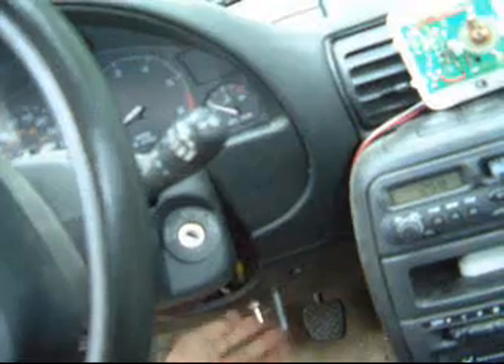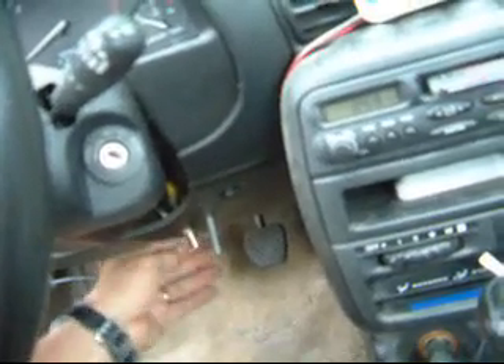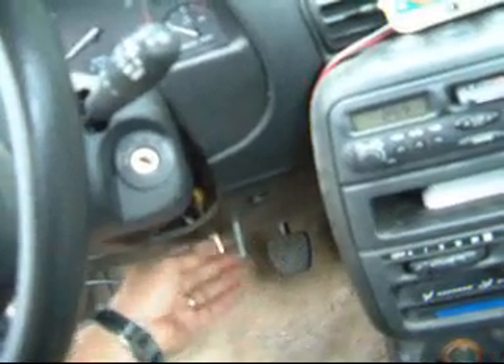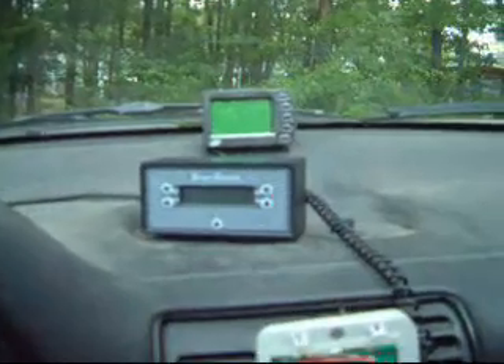Here's a switch that I had previously installed for the oxygen sensor — I haven't got it hooked up under the hood, but normally we would just shut that off to turn the circuit off or on, depending on which way we've got the switch connected. We adjust the circuit here, and we're going to turn it all the way back down to zero because we want a baseline test. We want to make sure our oxygen sensor is hooked up — we have it plugged in out there instead of running through the switch, so it's already back to stock. Now we'll go do a test using our scan gauge.